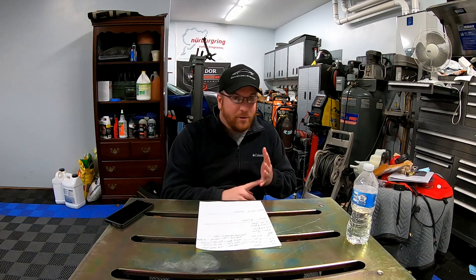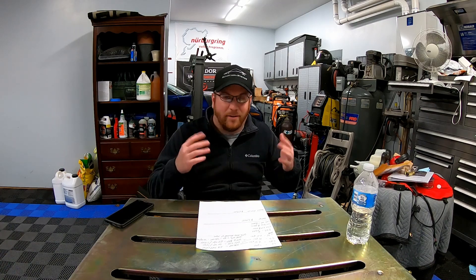I'm going to give you some numbers I've crunched based off my dyno experience. I've had the same silver heads the entire time — GM Performance Parts LS3 heads, CNC ported, same valve springs, those are Comp Cams 918 springs, FIC 1000cc injectors at 95 pounds an hour, and the same Kooks 1-7/8 inch headers throughout.